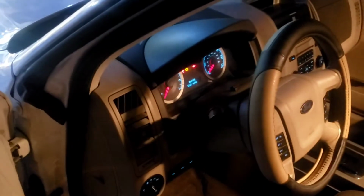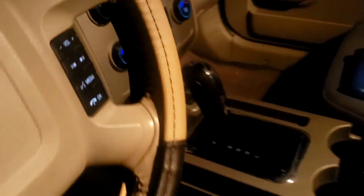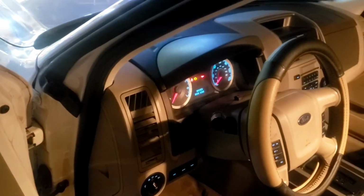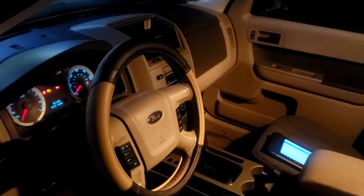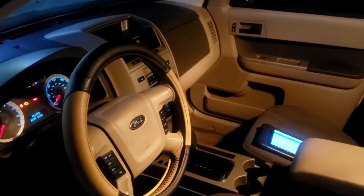So we've got to look at that cable and the range sensor. I'm sure it's something else the mechanic screwed up, because I did notice on the other end of the cable, where it goes to the transmission, it looks like the mechanic zip tied it on, which is not correct at all. So it may need a new cable. That's another issue. As we do more tests, we're finding more and more stuff wrong. But we did put all the panels back that he took off, so we're getting there slowly but surely. Just another thing we've got to troubleshoot. We'll continue to go from there.